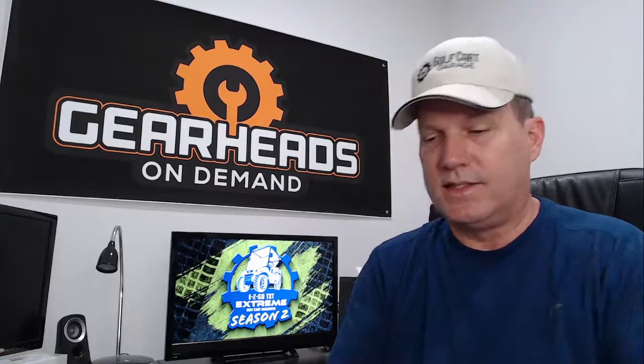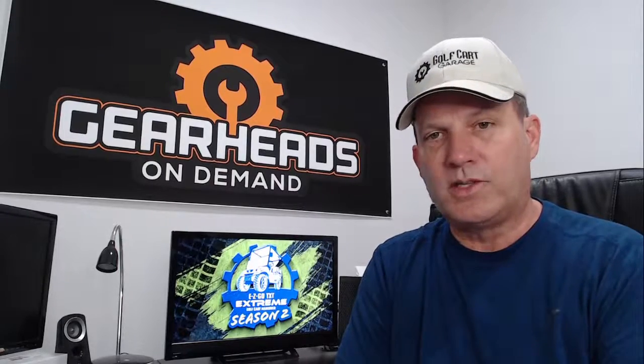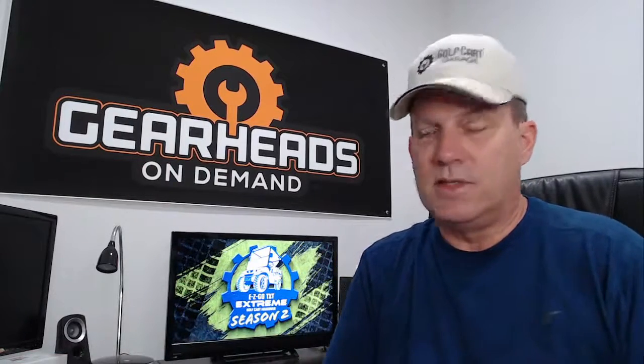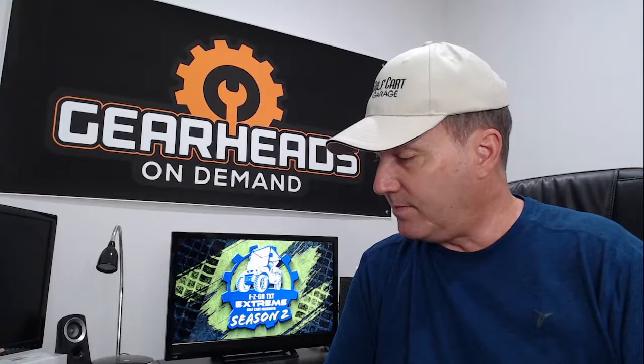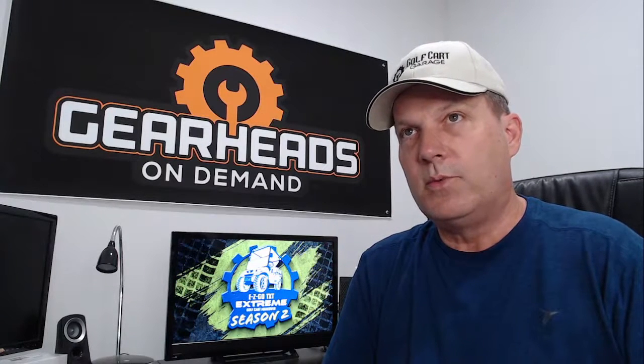But they can test that in 5 minutes. They can tell you whether your MCOR is going wide open or not. Your MCOR has to go wide open in order to tell your controller to go wide open, in order to tell your motor to go wide open. So that's something that they could do. That would be what I would check for.